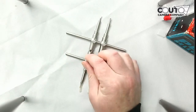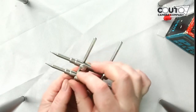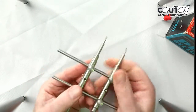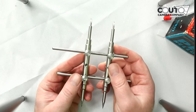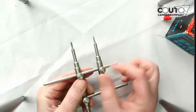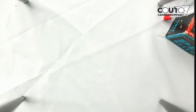Next we can talk about the spanner wrench. The spanner wrench has two sides — one side has points and another side has flat ends. Sometimes on a lens you'll see small holes that let you get in that way. These are adjustable and you just tighten it up when you're ready. The danger of using this tool is that it has a tendency to slip, so if you're using it around glass and putting a lot of torque and then you slip, you can scratch the glass. I've scratched my hand doing that quite a bit too, which makes it a double whammy. It's very sharp and it can scratch up the glass pretty badly if you hit the glass at all.